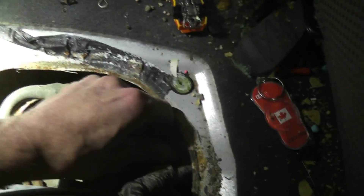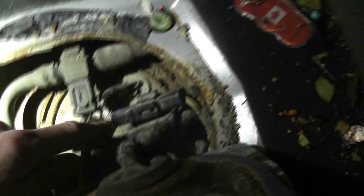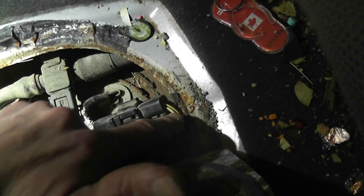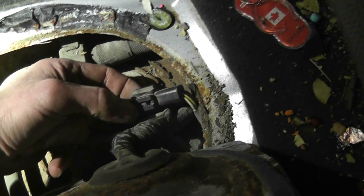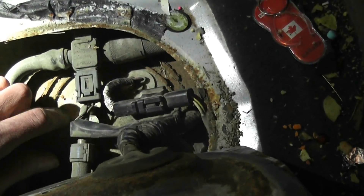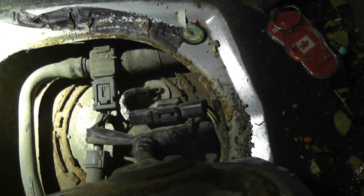So I pulled my fuel pump connector — and what I hate about this is the colors change from one side of the connector to the other. White is positive, red is negative. So I tested the pump: I put 12 volts to it and got a really nice clean sound. So it can't be the pump.